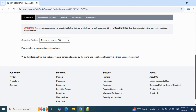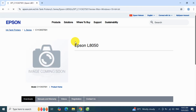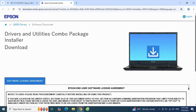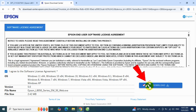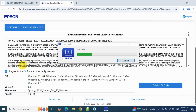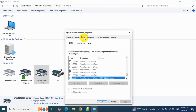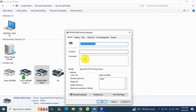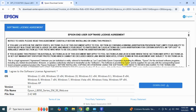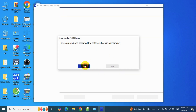Please note that the automatically installed Windows driver does not include the full printer options — it lacks the tools for nozzle check, print head cleaning, and other advanced maintenance features. Therefore, you need to download the official driver from Epson's website and proceed with the installation manually. Whether you print via USB or wireless, you must download and install the official driver from Epson's website.